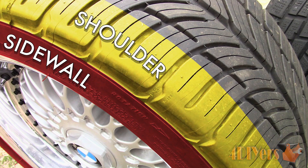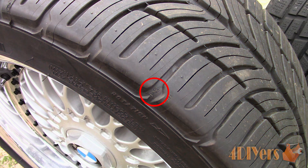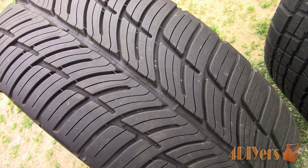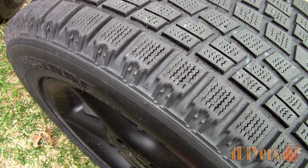First, inspecting the shoulder of the tire, which is where the tread starts as the sidewall ends. Here we are looking for a small arrow which indicates where the wear bars are located within the tire treads. Some may have text as well, which may be written to break down the tire into segments if you are recording the numbers. Wear bars are a raised portion within the tread grooves, which indicates how much life is left in the tires.